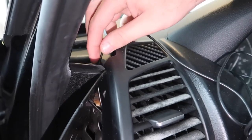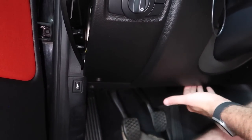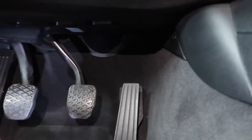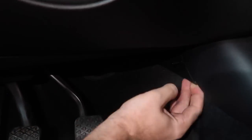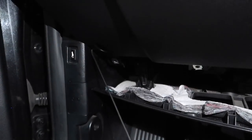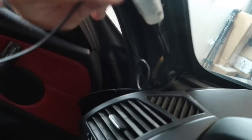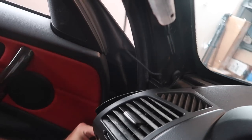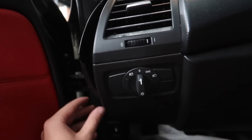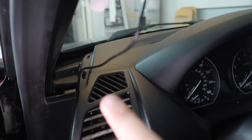We're just going to be pushing the wire down here - that's probably enough for now. The next step is to release all the bolts down here so we can get the wire to come through. Now that we've dropped this, feed all this through the top. Leave a little bit of slack so everything goes back properly. Then push the side trim piece back to where it originally is. Now that this plastic piece is back in, we have the cable right here and we can go ahead and put the A-pillar back on once again.